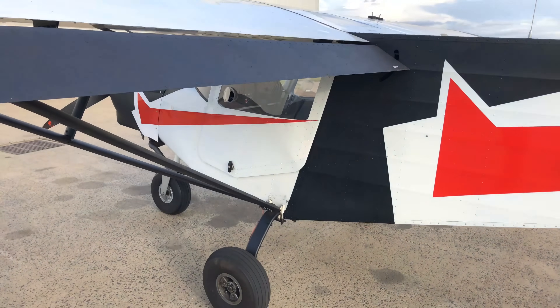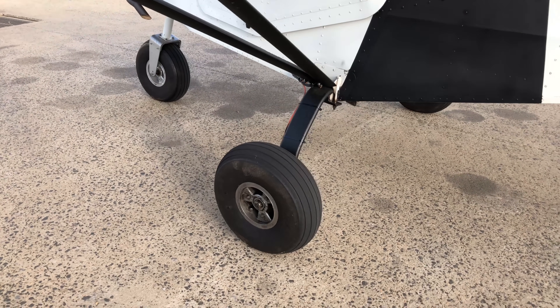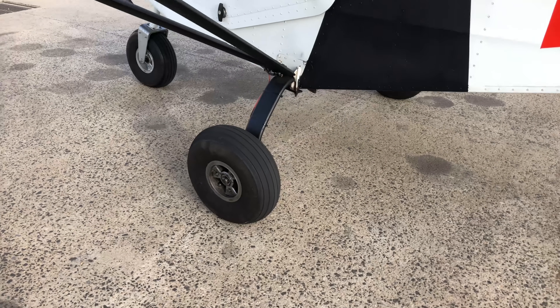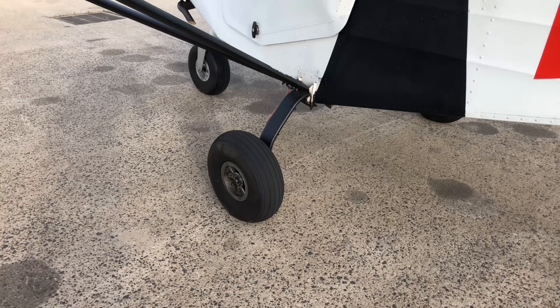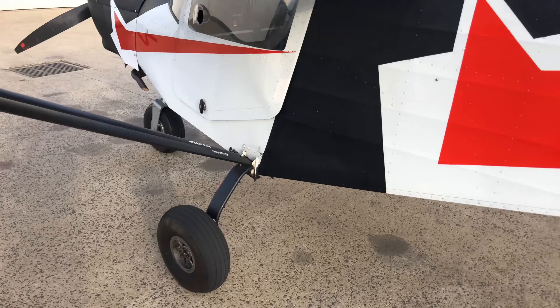I know it's a noticeable bush plane, but we do have fat tires. Trent Palmer and Greg Swingle don't need to stress out too much — we do have fat tires in the garage waiting to go on, but we need to upgrade the brakes first. With those fat tires the brakes just aren't powerful enough and you can't even do a run-up, so it just drags itself. The fat tires are going on soon.